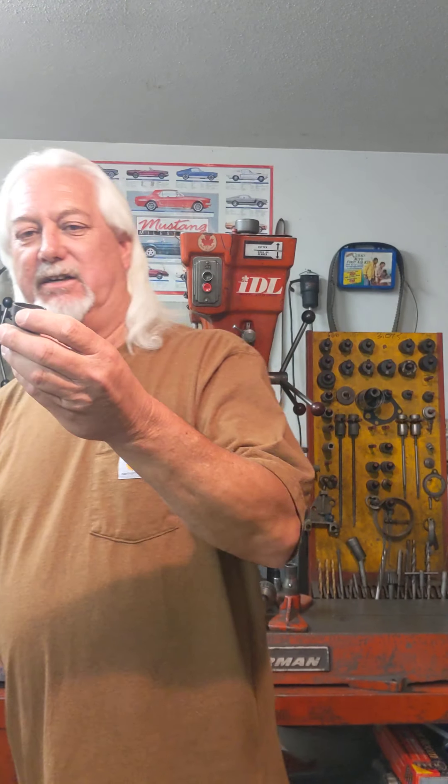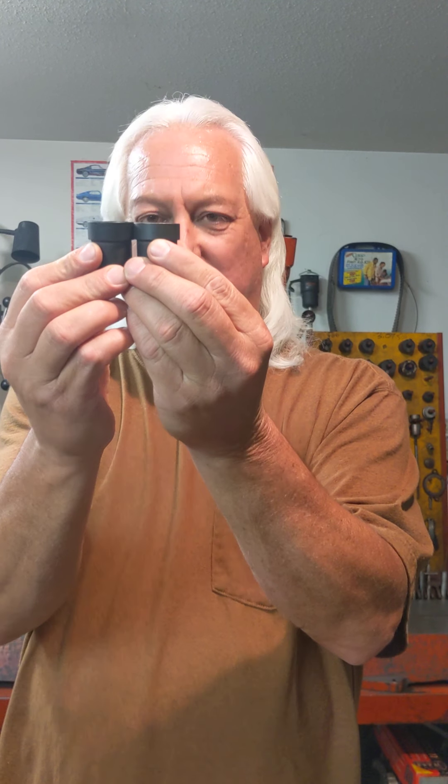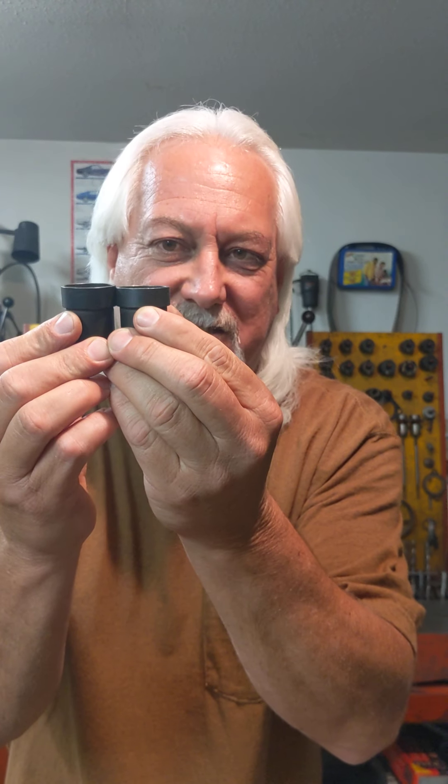Here's the 400, C's, and M's exhaust bushing, and here's the 302 bushing. If you try to get them together right there, you can see the difference. I know it's slight, but it's enough that at low lift it pulls that valve away from the cylinder wall. You might gain right there because of the time we're on the low lift stuff. If I can get the valve at 300 lift to be the same distance from the wall that it would have taken 375 or 400 lift to achieve without changing the angle — that's the benefit.